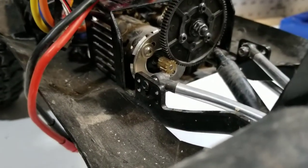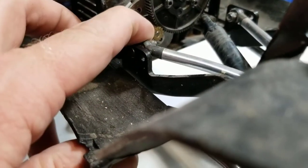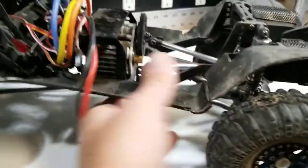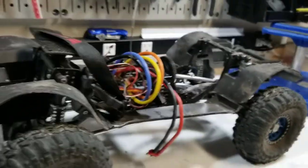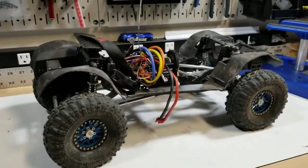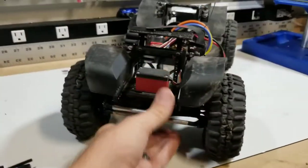It's powering a 17.5-turn sensor brushless motor. To keep torque twist down a little and give me better throttle control, I went with a pretty small pinion on the factory spur. I've been happy with that combo — it's by no means fast, but it gives me great low-end control and I've got some decent wheel speed if I actually need it to get out of some spots.